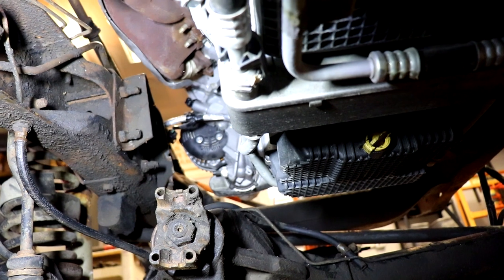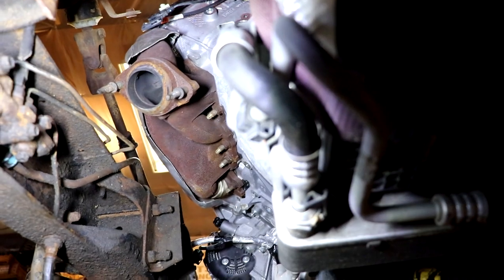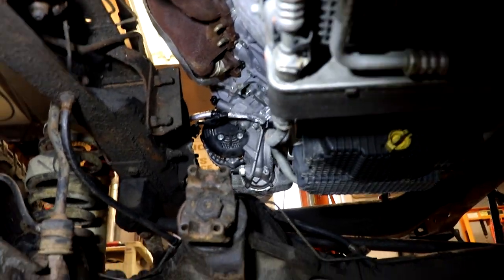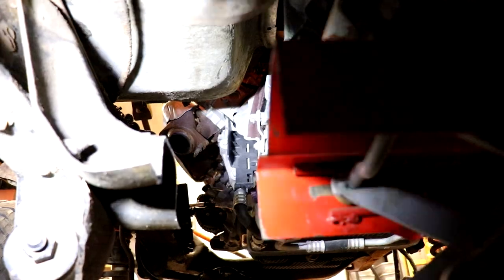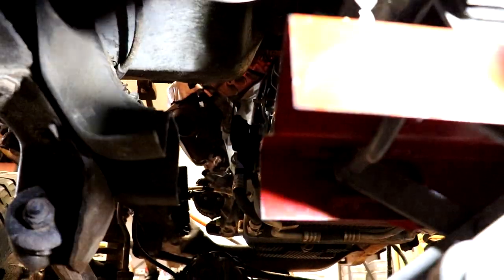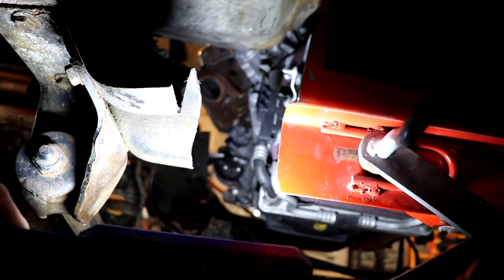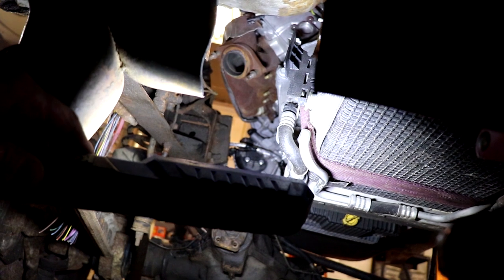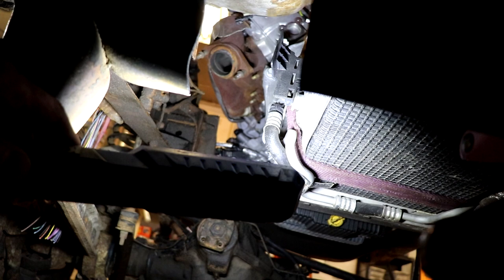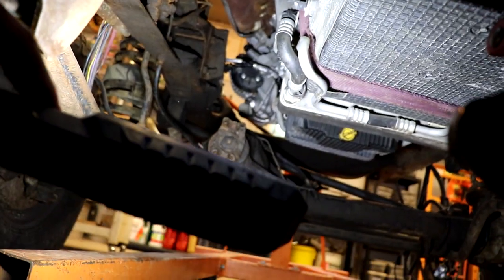You can see the back of your AC compressor and there are some holes up here where the mount needs to go. I'll get the mount on and extend it down, but you see the side of the frame there where it's cut - that's all filthy and it needs to be a flat plate to accept the receiving ears of the motor mount. Until I get that I can't set this engine down. On the other side, we have to duplicate the flat plate and the ears, and that is saturated with grease. The big kicker is that a drive shaft and an exhaust pipe are also coming right through this same spot - quite a bit of time involved in just doing this.